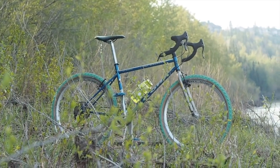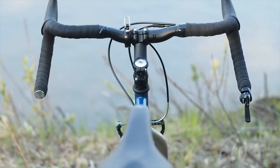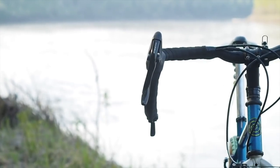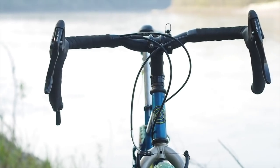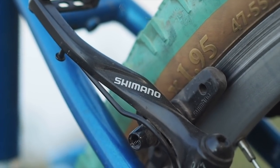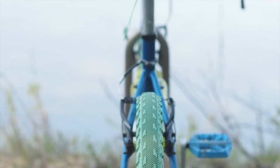It's as easy and painless as bolting on your drop bar of choice — in Mitch's case, this set of Specialized hover bars — acquiring some painlessly inexpensive brake levers from Tektro, and simply matching them with the easiest of tuning and powerful Shimano Alivio V brakes. And boom, you've got yourself unlimited drivetrain options and better brakes than 69% of the bikes on the road.